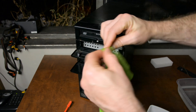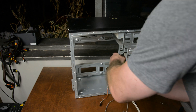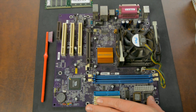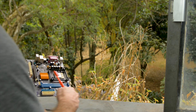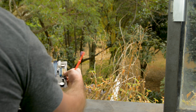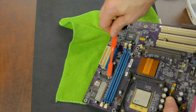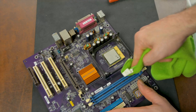I did have to swap that CD-ROM drive for an IDE drive, but it's a free drive so who's complaining. For the motherboard, we already know everything works so we can remove the memory and the CPU. The motherboard is a beautiful purple ECS P4V MM2 revision 8.1. It was sold to the value market — it only has two DDR memory slots and a maximum of 266MHz on the memory, but the main reason for using this motherboard is the universal AGP slot.